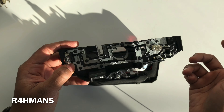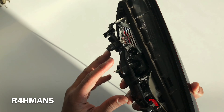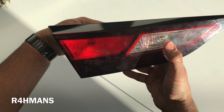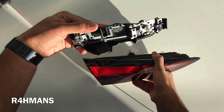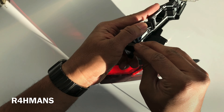To know which bulb is which: put it back in, look around, then take it out. You've got the reversing light here and your brake light here. The brake light takes the 501 bulb — just gently pull it out. There you go, just a standard 501.